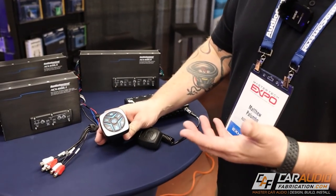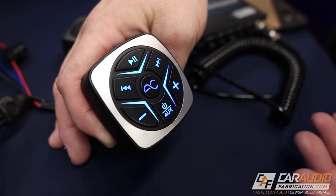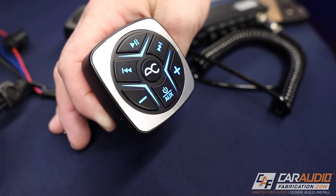That's super intuitive — you want it to be nice and simple. When you're out having fun, you don't want to be looking through a bunch of menus. The classic car market is really keen for us to release this — guys want to put it in a custom center console, keep it low profile without modifying the dash. A lot of the classic car community doesn't want a radio or a deck, but they also don't want to grab their smartphone every time they need to adjust volume. This also has an aux input, easy power on and off, and a remote turn-on output so it can turn on the amplifiers, which ensures you don't get any sort of turn-on pop or other annoying issues.